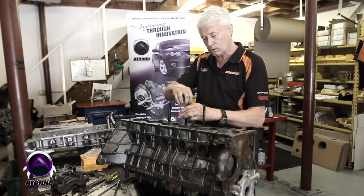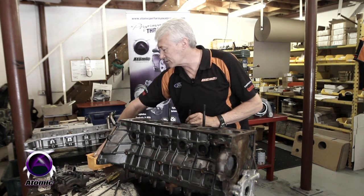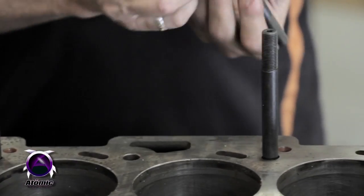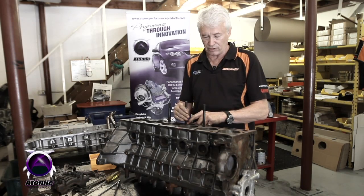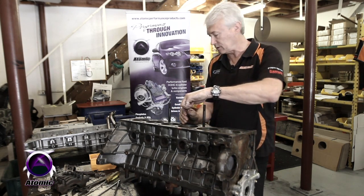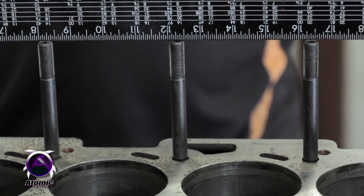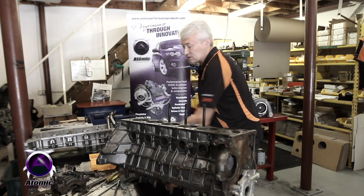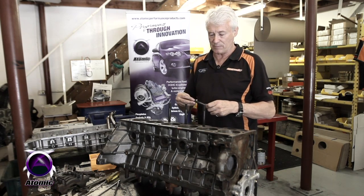The simple, cheap, quick, and easy way to pack the stud up when it's going into a blind hole — like these Fords — is to use a ball bearing. You can get ball bearings in different thicknesses from bearing service companies. All you do is drop the ball bearing down the hole; it will register against the end of the stud, give you the correct amount of thread engagement into the block, and push up against the top of the thread as it's supposed to. Wind it in by fingers, check it again, and we're back up to a much closer height — within a few mil, probably two to three mil.